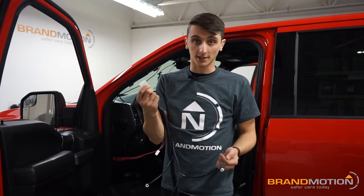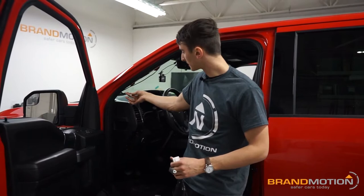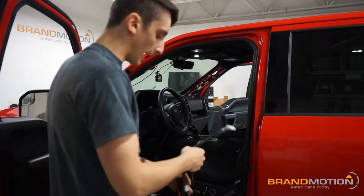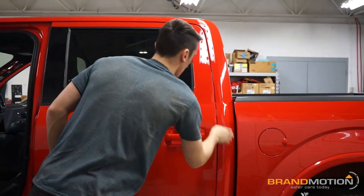The ECU is hidden away and tucked up, mounted underneath the dash. Since then, I've made the connection with the main connector into the ECU, run the shorter HMI connector up through the dash and into the other pillar, ready for when it's time to work on the HMIs. I've also grabbed power and ground — laid out on page two of the instructions — at the ignition switch and a clean chassis ground, as well as the signal connections.